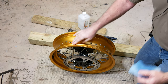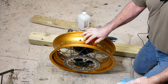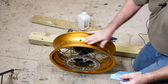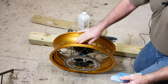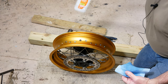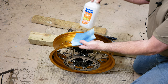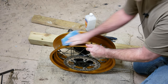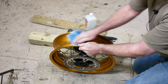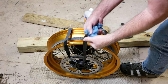Prepare this wheel. I'm going to be gluing these rim strips in place with 3M weather strip adhesive. I want to get all the oils off of it and get this really clean. So I'm just using regular old rubbing alcohol and a soaked rag. We're just going to clean this off where we're going to be gluing these rim strips down in this part of the wheel here. I'm wiping my rim strips down with alcohol